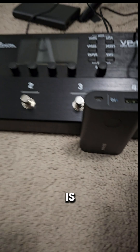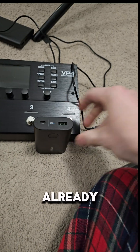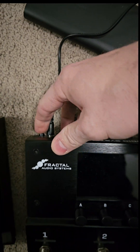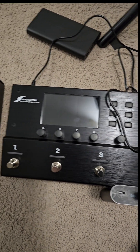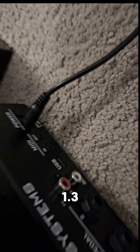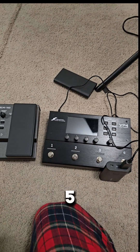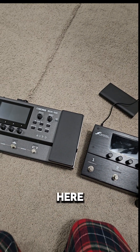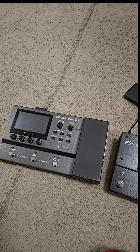This one is quick charge capable — Qualcomm 3.0. It's already a few years old now. So let's see if that makes any difference. Nope, this guy just needs a little bit more power — 1.3 amps. I think with the up-conversion we're doing around 800 milliamps total supply. This unit only wants 600 milliamps, so it should be fine.